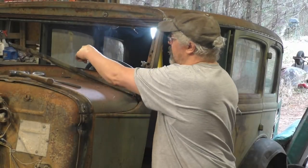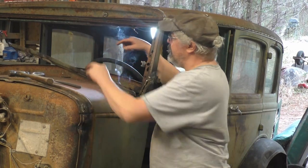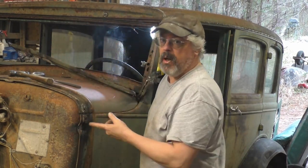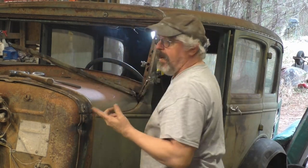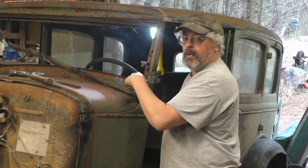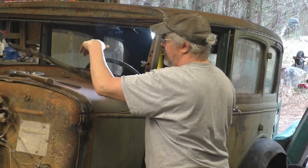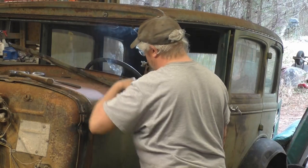All right, I got all the bolts out across this dash rail right here. There was two screws over there. One of them come out, one of them I had to basically just break out on the corner down there. And then over here, imagine most of y'all watching me earlier knew there was a bolt down in this corner that I didn't know was there. So I get over here trying to take the tank out and it still won't come out. And I remembered I found a bolt down in that corner and sure enough, it's right here too.